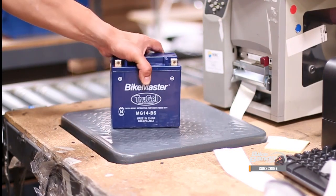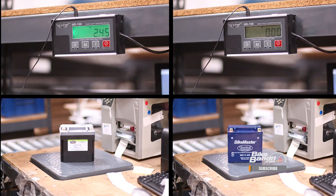For the last battery in our breakdown — lithium batteries. This is the Corvette of the battery world: a little pricey, kick-ass performance, and very high tech, but not your first choice for ruggedness, and when it's snowing out, forget it. Lithiums are going to be the best choice for high performance riders. They're super light, so if shedding weight is important to you, this is one of the best bang-for-the-buck mods you can do. We weighed this Bike Master lithium battery against the equivalent Bike Master AGM battery and it only weighed 2.45 pounds against the AGM's hefty 10.1 pounds. If you're a racer or a track rider, you shouldn't even be thinking about any other battery. But remember, they get finicky in the cold and need to be treated special, so if you want something that will start in all weather conditions — like you ADV and touring guys — you may be better off with an AGM. Dirt bike and sport bike riders, though, will love these light and powerful lithium batteries.